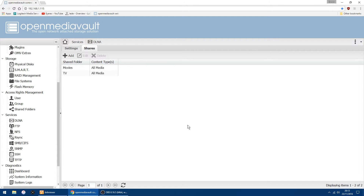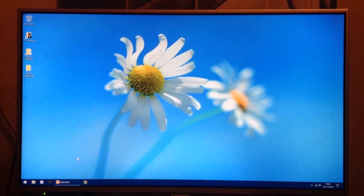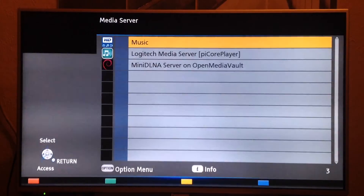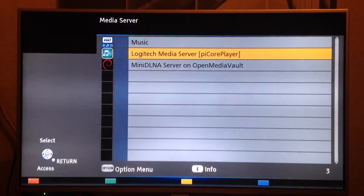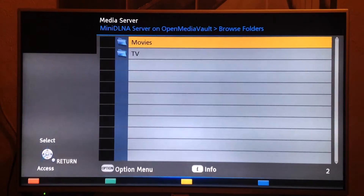And that's everything done now in Open Media Vault — you don't need to change anything else. So now I'll swap over to my TV and show you it running. Right, you've got the DLNA server set up on the Pi using Open Media Vault. On my Panasonic TV, if I go into Apps and then Media Server, the top one is My Cloud WD which has my music on it, the next one is Pi Core Player which is my network music player, and the miniDLNA is what you just set up. I'll go into that, click OK, browse folders, and go into my TV folder.